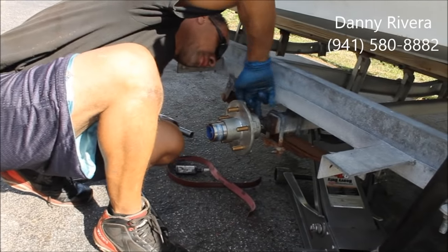All right, here we are on my personal trailer for the bearing buddy, so it won't spit them out. I usually give it a couple of tack welds. I only do this when I replace everything brand new. So like that, you won't really have to take it out for a while if you put it in salt water. Sealing in it, and you're good for a while.